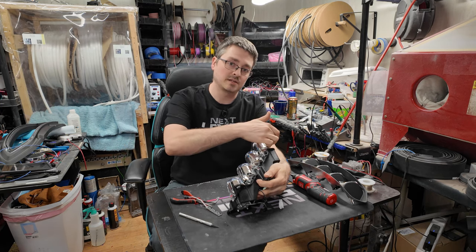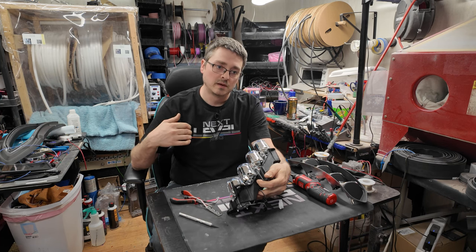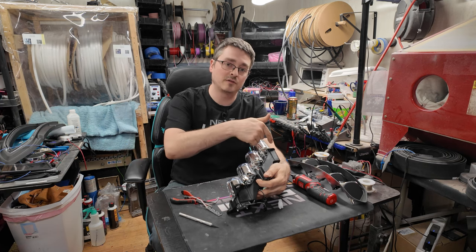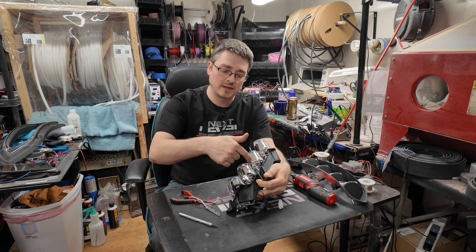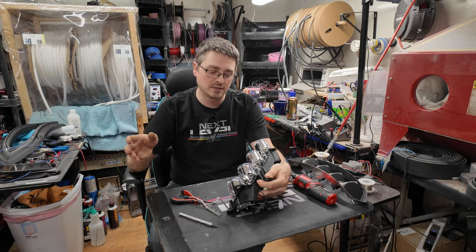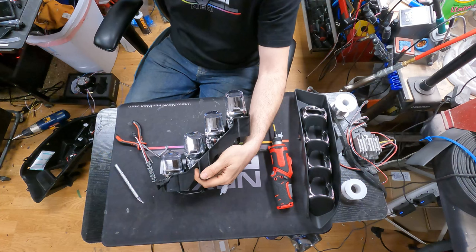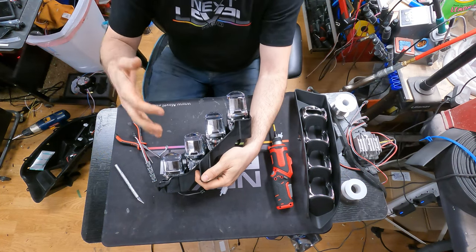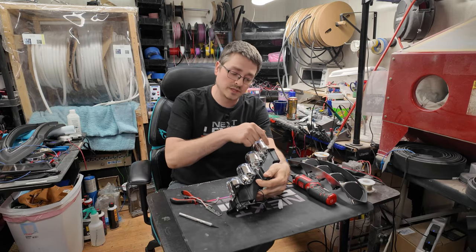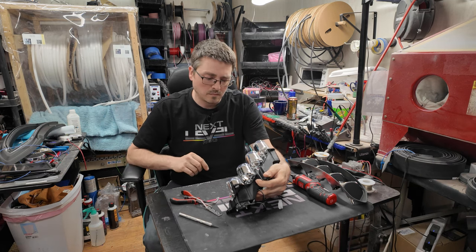So what I'm gonna do is power inject at the front, power inject at the end, and then I'll have my data out from here that will go to the front bezel, where I will have that power injected going to the front bezel. That way I don't have all the power for the front bezel coming through this strip, through that strip, through that strip, through that strip, and then to the front bezel where I have a ton of LEDs. Instead, it's going to be power injected here, power injected here, and power injected going to that front bezel. So the load is going to be much lighter on these first LEDs here. But that will be the plan. Directly from the Ghost controller, this will be the first LED from the controller into the light. So hopefully that makes sense.